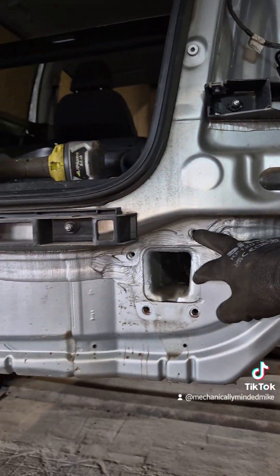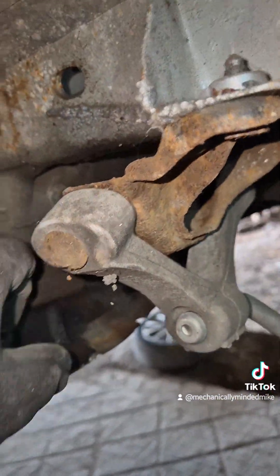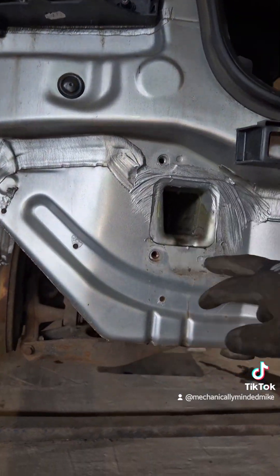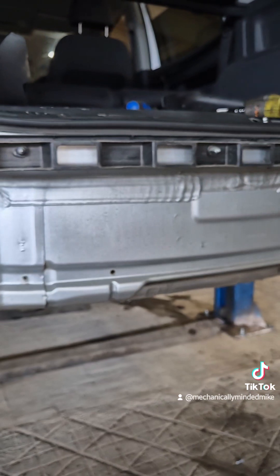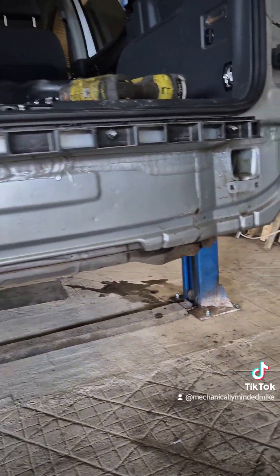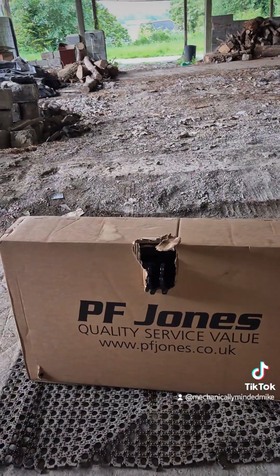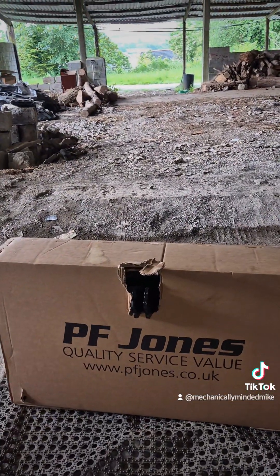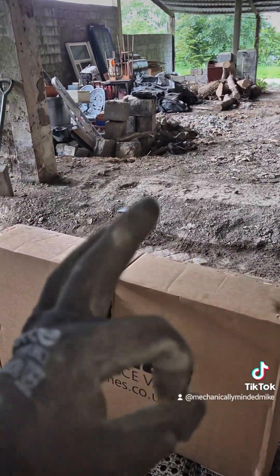That'll make sure your bumper goes back on properly. There's a crash bar here with 13mm bolts — again, these are quite stiff and tight to get to, so make sure you wire-wheel them clean. There are only two here — that's the VW life. That's off. We'll now start to piece together the instructions for the bar. I must admit, I've always bought my tow bars from these guys whenever I fit them for a customer — highly recommended.